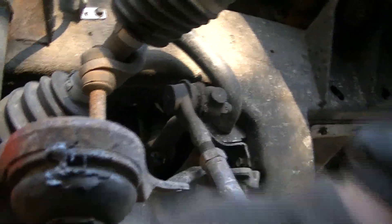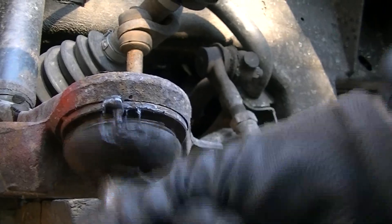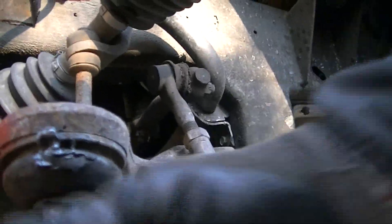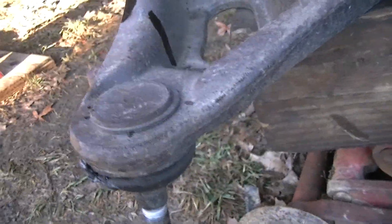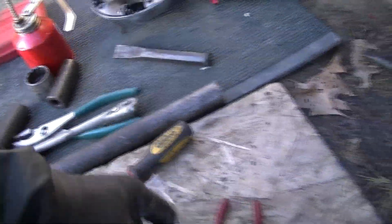The axle is sitting up like that, and here is the lower ball joint. You want to see how bad it is? I'm sure there's been worse, but it's bad — it's not supposed to be able to move around like that. I can shake it up and down. The principle behind this ball joint is you take this clip off on the top, and once you take that clip off, you push down — that clip holds it in — and when we press it back in, we push it back up and put the clip on.